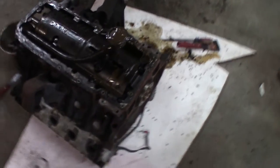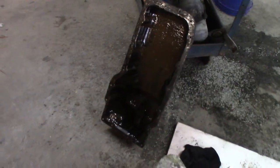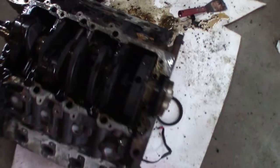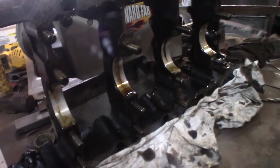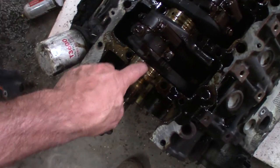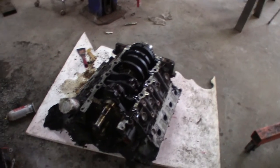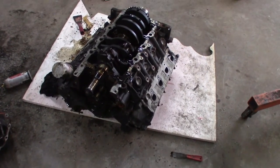Got the pan off and now it's all a grey, watery, oily mess. But all I want is a tone wheel, then the rest is going out to the scrap pile. I did get the bed plate off and these bearings look good. The bearings in this junk motor look good — they're all clean, not scored, not down to nothing. And the crank can't catch a fingernail anywhere — it's smooth. Maybe I'll put the crank on eBay or something. If not, I'll just scrap it.